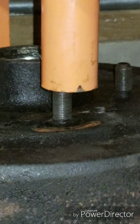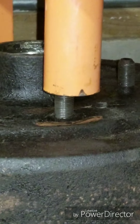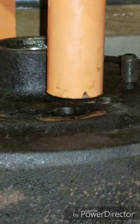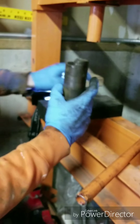If you look at the bottom of the wheel stud you can see it pushing right through, and the hub - or in this case the drum - is not flexing at all, and the hub shouldn't be either. We did not remove the swage beforehand, so as long as you have it properly supported it should push out pretty easily - by easily I mean with several tons of pressure.